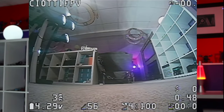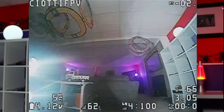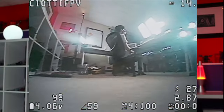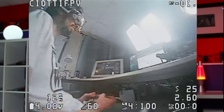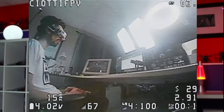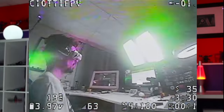All right, cool. Here it is on the HQ YOLO Triblades. Whoa. All right, so here is what it sounds like when your PID tune is cranked up a little too far. Listen to when I chop the throttle, ready? Hear it? Hear the second little whir. You could almost see it there.